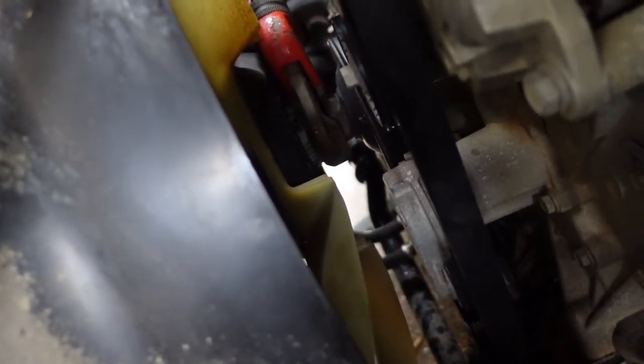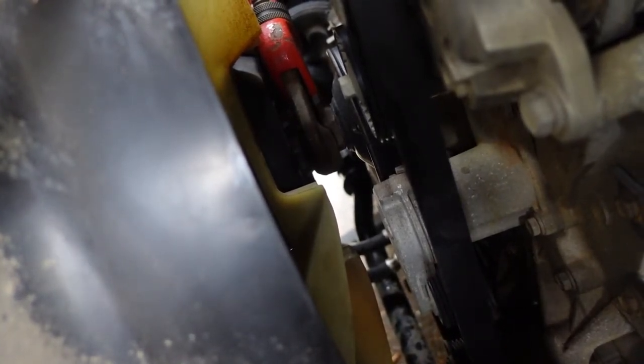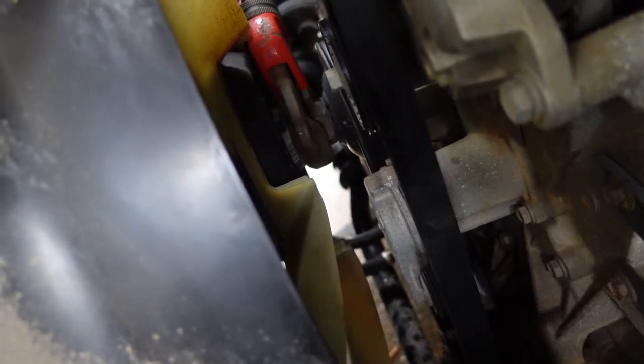The tool that I rented isn't the right one for this pulley, of course, because the proper tool for this one has pins that are 90 degrees to the handle. This one does not have that. And I have a 1 5/16 wrench. This requires 1 3/8. Joy.